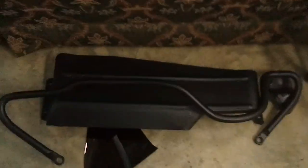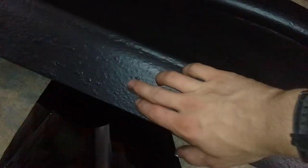It's my little painting section area. But this stuff here, like this here, my sway bar is in pretty much perfect condition. This is in alright condition. Some of it's pitted, but these little pop-ups, you can probably see this one on camera, yeah. This here is what I'm talking about. It'll do, and I took a wire brush to that with a grinder. It don't come off. Some of it did, some of it didn't, and I just left whatever wouldn't, primered it and sealed it off. So it's good to go.